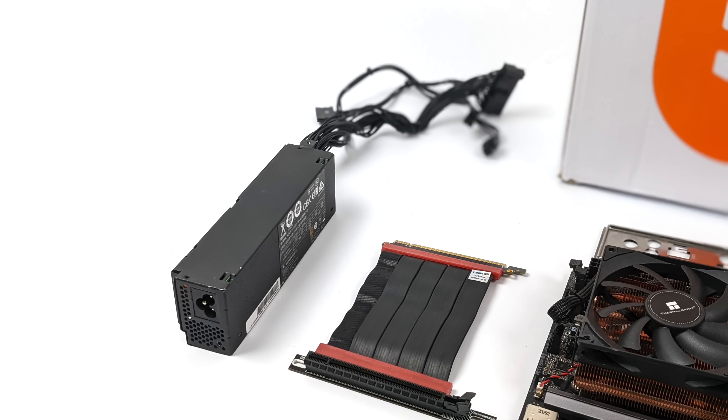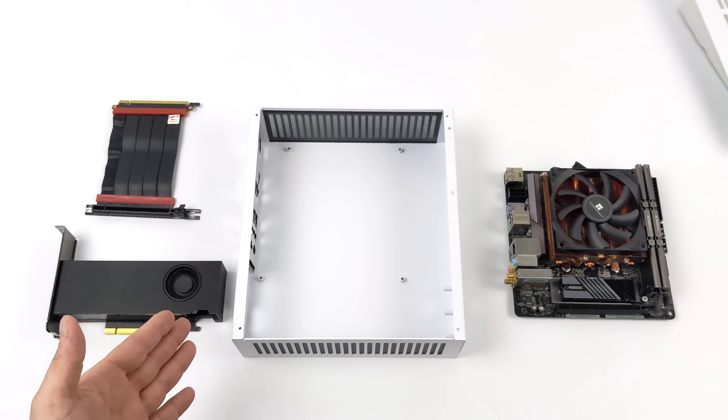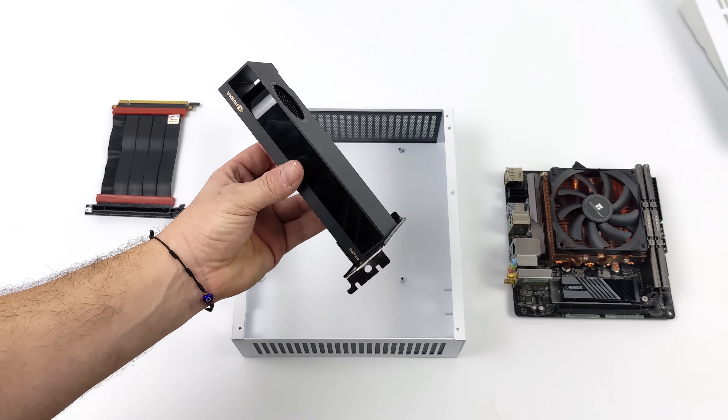Of course we're going to need a power supply for this build, and the smart thing to do would be just go with the Pico power supply, and that would use an external power brick. But recently I was on eBay and I saw somebody selling a couple of these InWin Chopin 200W PSUs. As you can see, it's a very funky form factor — it's kind of a half-height 1U power supply, but it should fit in this case pretty nicely. I'll tell you, if I had to do this over again, I would have just went with the Pico power supply. Around 230 watts would be more than enough for a build like this. We've got that mini ITX — that's going to fit in this case really nicely, but then we've got to worry about fitting this GPU in.